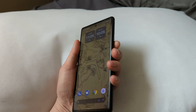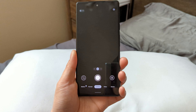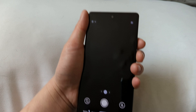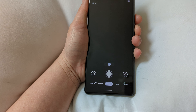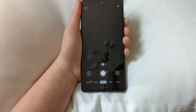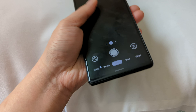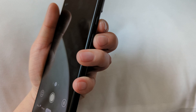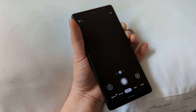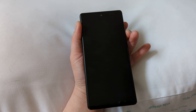Any application that uses the camera crashes right away. There's the camera — it's a black screen, completely locked up, and you can't do anything about it. We've tried all the suggested fixes: updating everything, it's on the February update right now, and we updated all the applications including the camera app. It just heats up if you leave it there. When we try to reboot, the buttons are unresponsive — it just straight locks up. The only thing you can do is push and hold to force it to reboot.